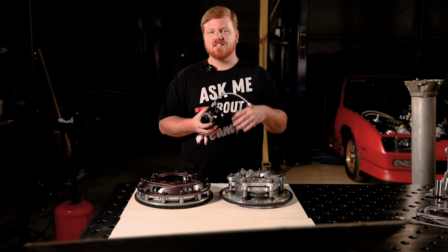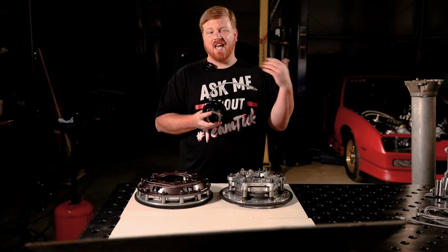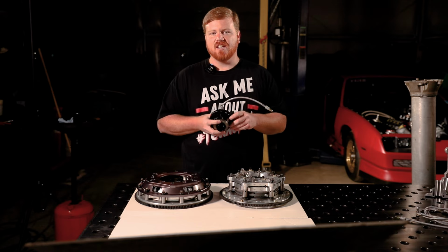One thing to note is that if you have a mechanical stop on this end, well, then there could be potential for a problem on the other side. If you ever run into a situation where you're bottoming this out at speed and you don't know that you're doing it, you can bend the master cylinder rod, because once this thing stopped, there's nowhere for that pressure to go, and if you build up too much pressure, something is going to give. That's just a common part of hydraulics. That's how it works. There's no bypass in one of these clutch systems, so you don't have a bypass for that pressure. So if you deadhead the pressure, something has to give.